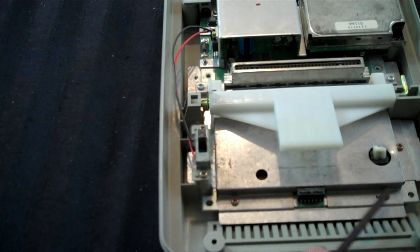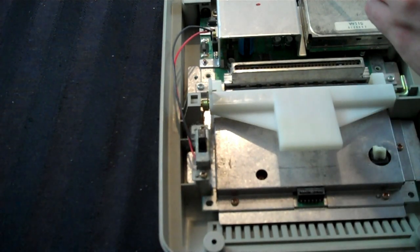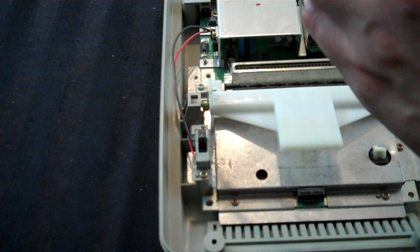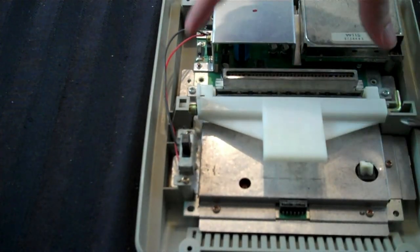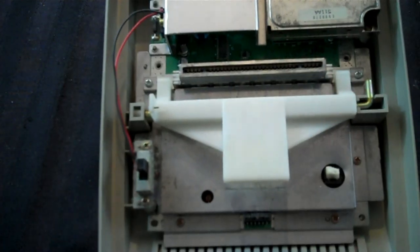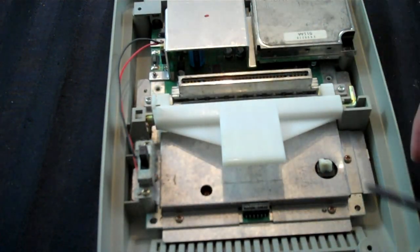Back to the system, we'll keep taking parts out. We're going to find all the screw points — there's one here, one here, here, here on the soundboard, other side of the soundboard, silver, silver, silver, and then of course the two by the power switch. You need to remove all those. Remember that there's two silver ones here that are probably going to be slightly longer. And two other silver ones back there — they might be longer, they might be the same size. Just remember where those come from.